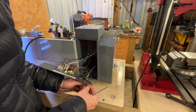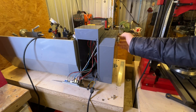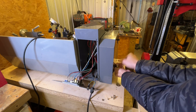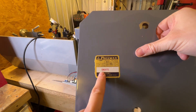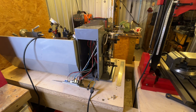Put the screw through the ground strap and then screw it on when you reattach it. The last time I bought one of these belts I kept the label and stuck it on the side here — it's a Polymax 5M 375. In the book it says 65 for some reason, but the 65 is a bit too tight. Somebody else told me another size, so I don't know if it differs between machines, but on this machine it seems to be the 5M 375 Polymax belt.